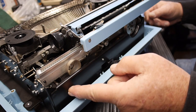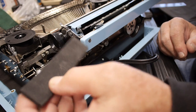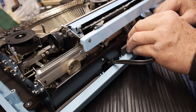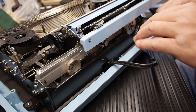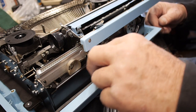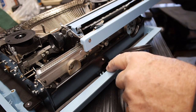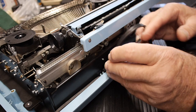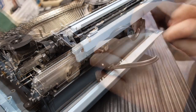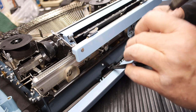In the back of the machine, between the back panel and the rear of the bottom body shell, there's a little gap. I've cut some strips and I'm putting them right in there to add a bit more sound insulation — I've already fit-checked it and it will not interfere with the top body shell seating. I could also cut another little piece for right in here where the power cord is, and there we go — that extra piece of insulation fits in the gap underneath the power cord really nicely.